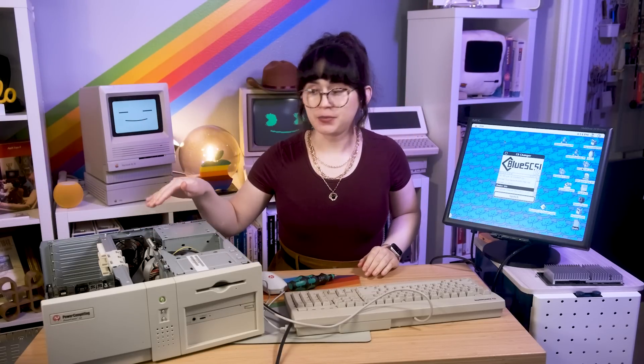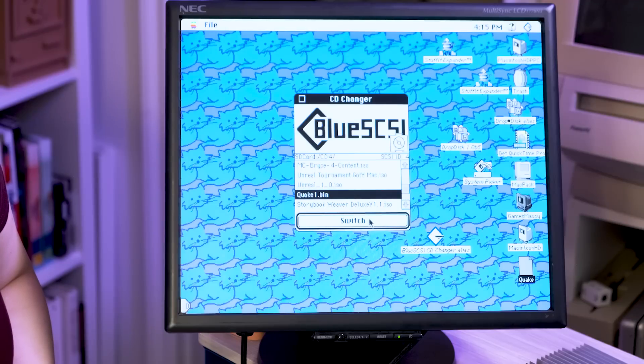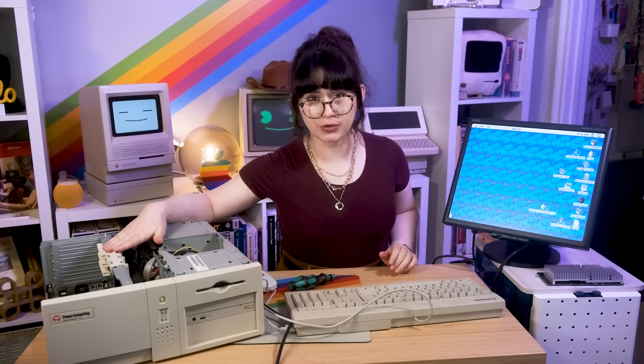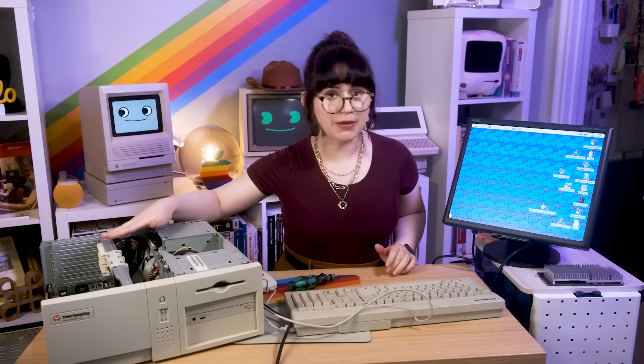Today I went ahead and loaded up the SD card in the BlueSCSI version 2 with some ISOs. Right now I have the Quake bin selected. Let's go ahead and launch Quake and get that installed. Right now I don't have a graphics card inside this Mac — that is something I'm looking to get. The next upgrades will be maxing out the RAM and getting a nice graphics card, maybe one with a built-in TV tuner, so we can run 3D accelerated OpenGL applications and possibly upgrade to OS 9.